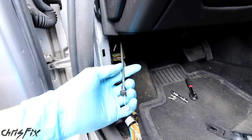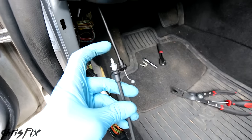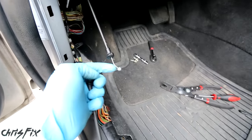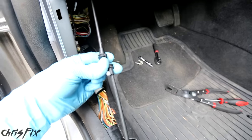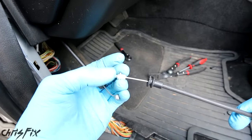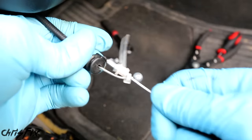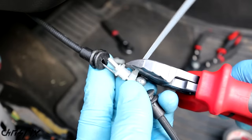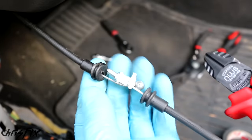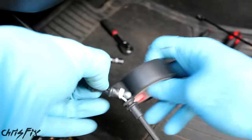This next tip is going to help so much — this is the hardest part of the whole job. Before you remove the old cable, grab the new cable. Get the end that's going into the engine compartment, because we're going to tape the new cable to the old cable and pull them through together. That way you don't have to manually push it all the way through with all the wires in the way. Make sure you have the right side — this end goes into the engine compartment to the hood latches. Use zip ties and tape to secure them together, cut as close as possible so there's no big piece sticking out. Tape them to make it more streamlined and prevent snags.